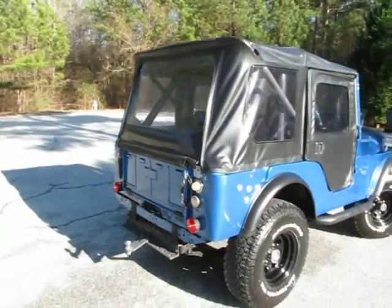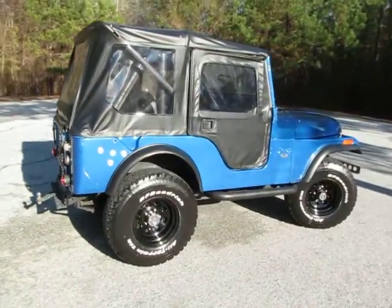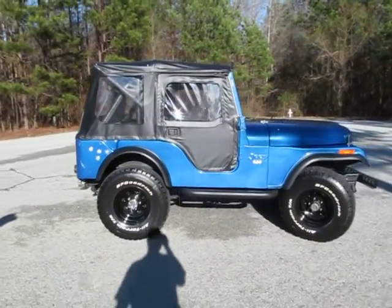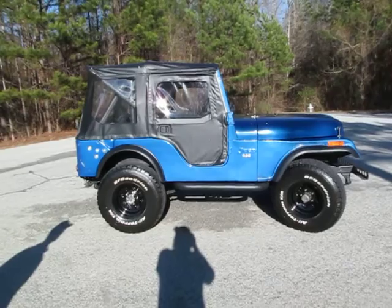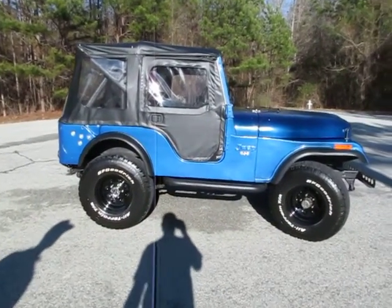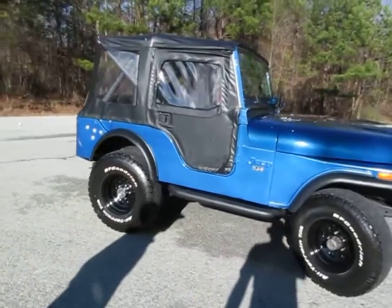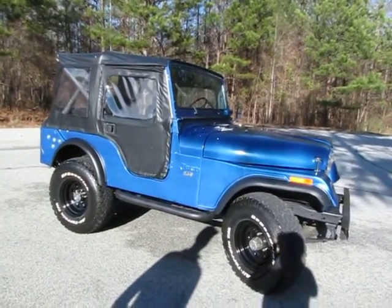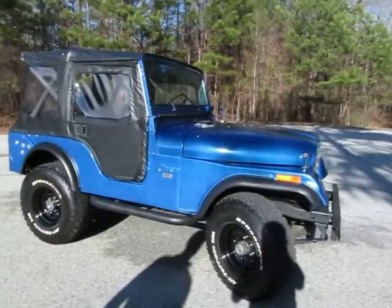You just put those brand new wheels on, man. They look awesome. Yeah, it's got brand new 15-inch rims. Look at those things, nice shine. Chrome center caps, actual metal center caps in the rear. Four-wheel drive works good. I rebuilt the front axle on it because the knuckle joints were really bad. So those have actually been rebuilt, along with the locking hubs. Okay, great. That's good to know.